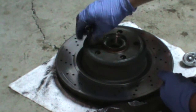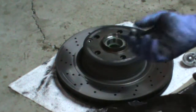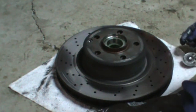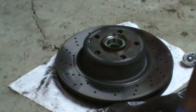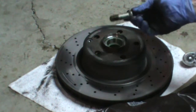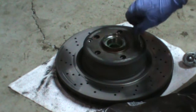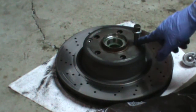Normally when this is done right, you just take this screw out and the rotor comes right off the hub. But in my case they're stuck together. The rotor has through holes and the screws for the bolts are in the hub, so I'm going to plug the holes that are in the hub and spray around these.